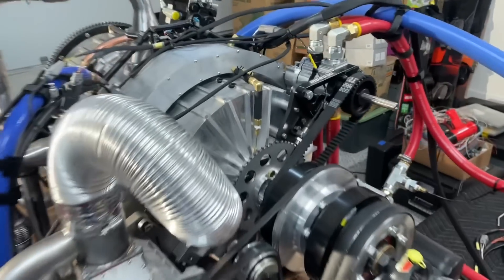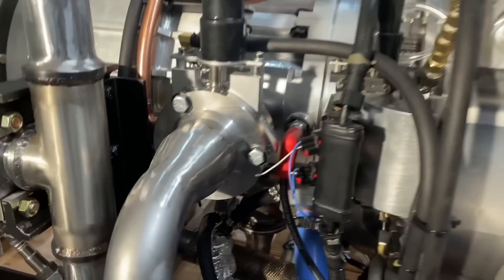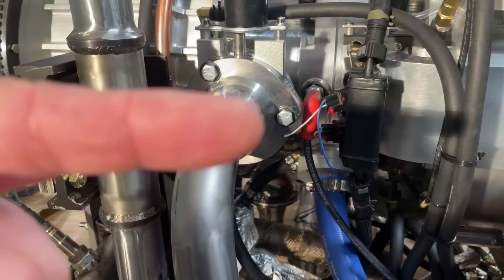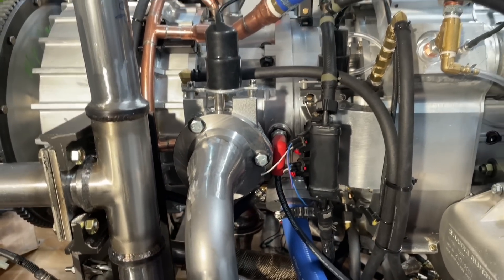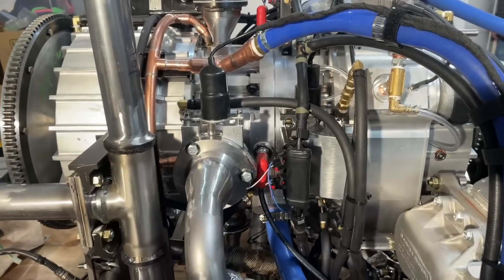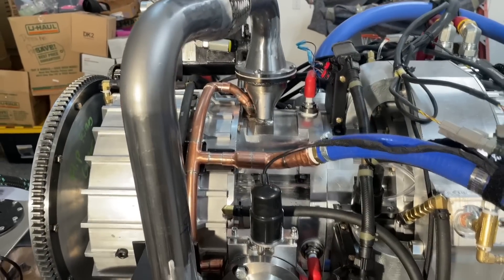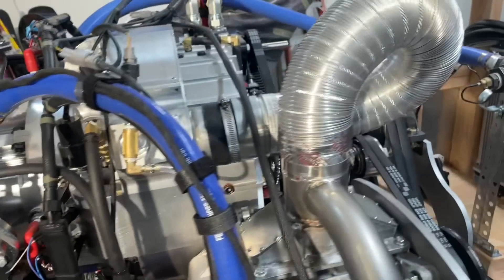It was 60 minus two. We were just working out where TDC is, which was a little bit of a trick. You take the plug out and you can see the two pistons — they come together in the center like this and make the combustion chamber, which lines up with the plug hole. So it's two-stroke; one cylinder fires every 90 degrees. You've got the one at the top as number one, and then this would be number four as the crank rotates this way around like a normal engine from the front or from the rear.